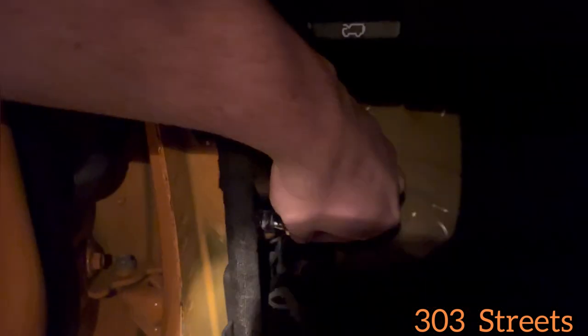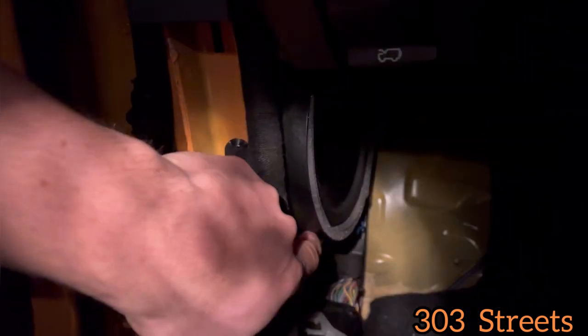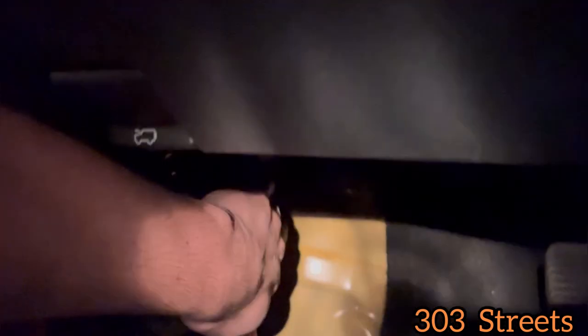There's my speaker wire that I'm running. In my case, I'm going to be removing this speaker. The next thing I'm going to need — let me move this so it doesn't get lost — was a seven millimeter socket. Yes, seven millimeter socket. So there's going to be three bolts to remove: one down here, one up here, and then one around in the back.